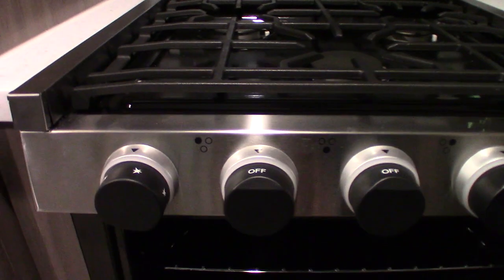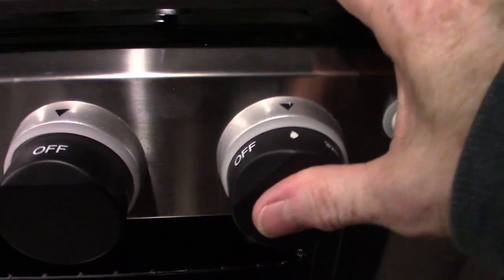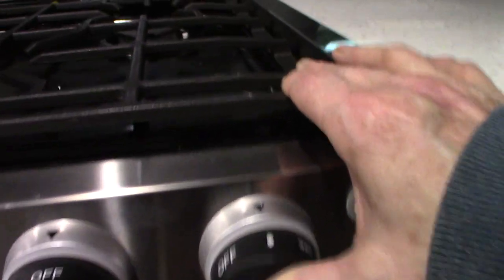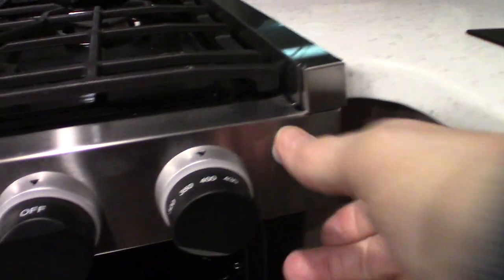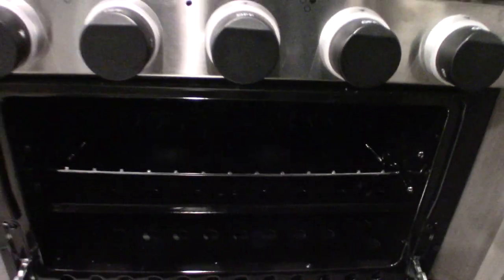The oven's a little bit different — the oven has a pilot light. The pilot light is all the way at the back on the bottom. So what you do is go to the oven knob, go to the picture of the flame, then depress it and keep it depressed. Spark it with your left hand until you see it light down there. Once you see the pilot light, you still hold it in for another 10 or 15 seconds to heat up the thermocouple. Then you go to operating temperature and it cycles as an oven does. When you shut it off, the flame goes out, but so does the pilot light — so you have to relight the pilot light each time you use the oven.